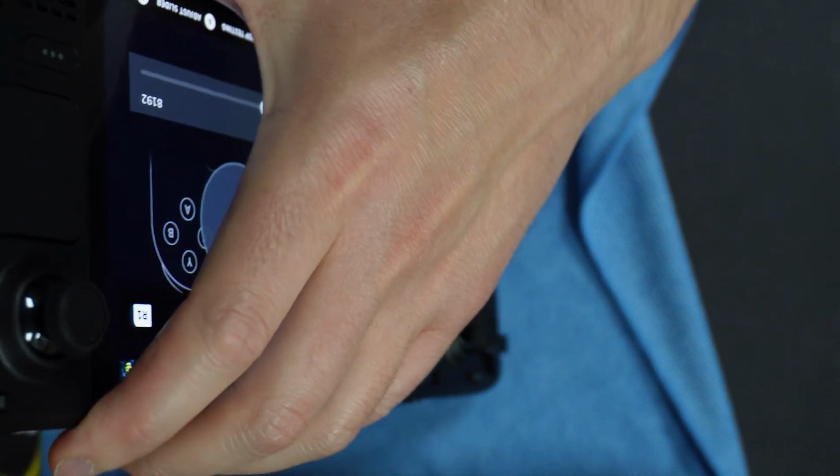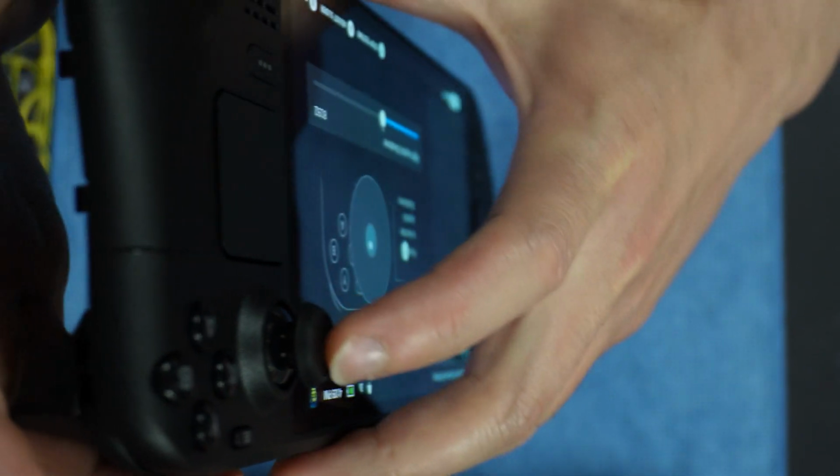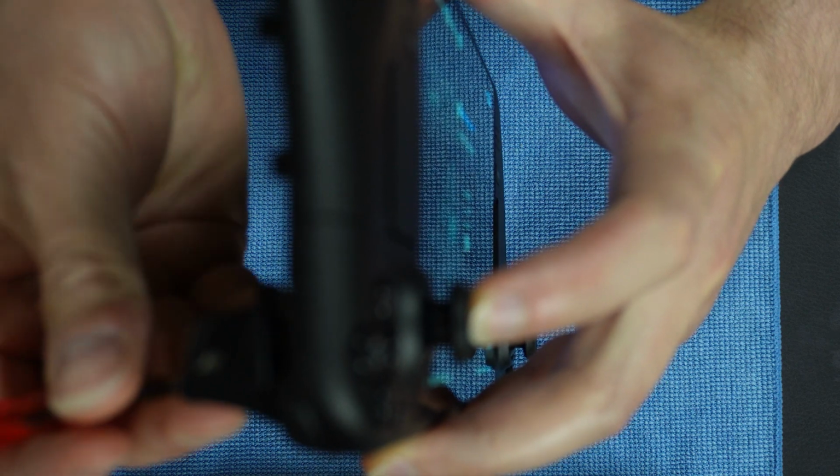Once you initiate testing for a joystick, i.e. by pressing the Y button, stand the Steam Deck OLED with the side having the joystick you are not calibrating at the bottom, touching the surface, while the side having the joystick you are calibrating is closest to you. Take your left hand, if you are right-handed, to hold the front of the Steam Deck OLED while your left pointer finger touches the top of the joystick you are calibrating.